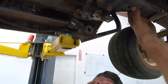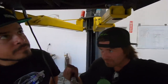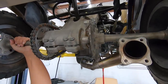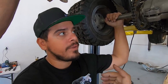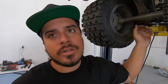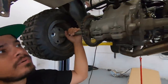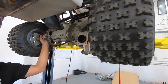Brent's been messing with that and it's just about ready to go. We just have to get this fully welded out - he drilled a hole up through there to mount it, and it looks like it has plenty of throw so it's gonna work good. Then we have to get a brake line made to run from there to the caliper, which we don't have figured out yet. We were trying to find a caliper for this exact rear axle, which is off a 450cc ATV, but no one has it in stock. I found a guy that has one for a 250 - I think they're supposed to be the same - and they open at eight in the morning, so I'm going to go see if it fits.